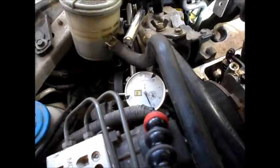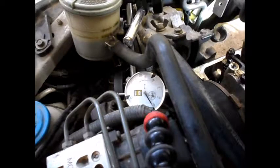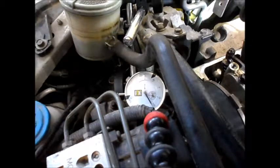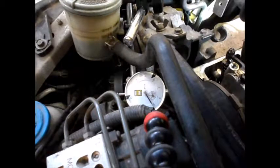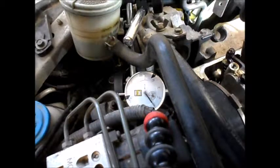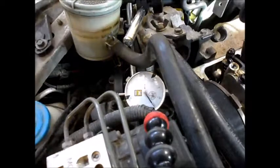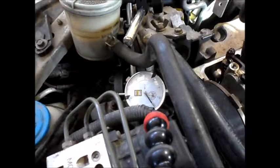If you watch the dial indicator, as hard as I can do it, the most I can seem to get is 1, 2, 3. If I push really hard, maybe 4. Yeah, around 4 thou. I can't get any more than 4 thou, and that's putting quite a bit of force on the screwdrivers. I don't want one of the screwdrivers to slip off and scratch the cam surface. So that's 4 thou.